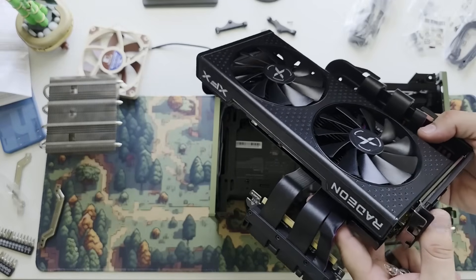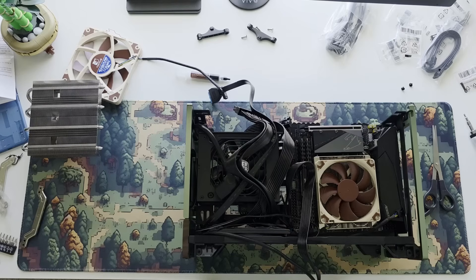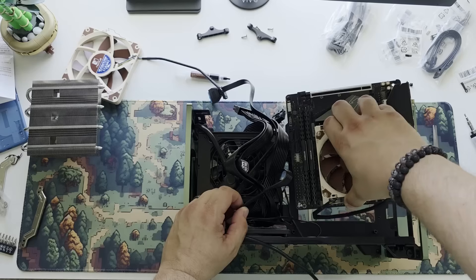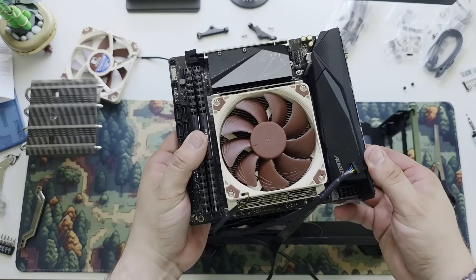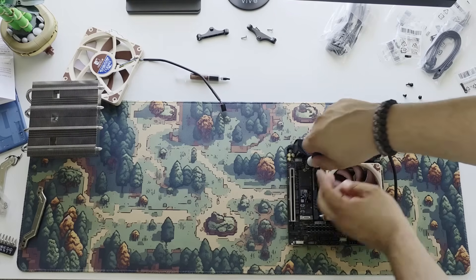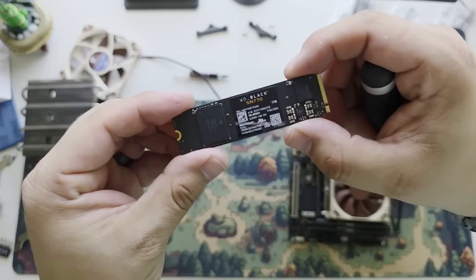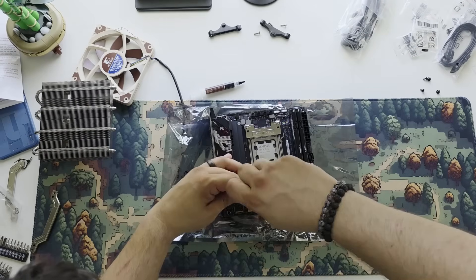I don't plan on purchasing a new graphics card just yet. Remove the screws holding down the motherboard and remove it completely from the case so we can get to the SSD. I'll be saving all of these components to repurpose in the future, not just tossing them. Now it's time to remove the SSD from the previous board so we can reuse it in the new build. I will note, however, we will have to reinstall Linux going forward to properly set up the new build. Installing the existing SSD into the new build is one-to-one from the previous build, so it's very straightforward.